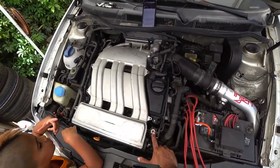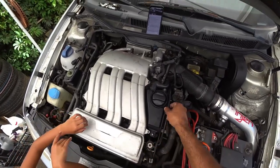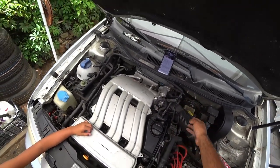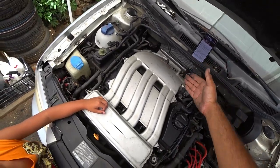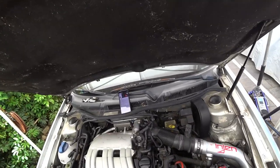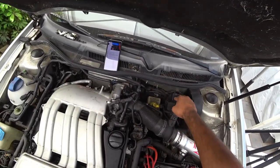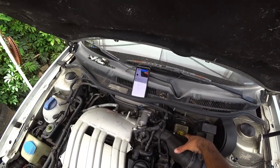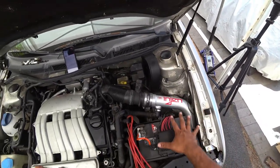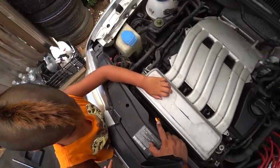Right here you have your fuel pressure regulator, vacuum controlled. The vacuum lines run all the way underneath the car and underneath the intake manifold. Let's see what else we see on top. Common on 1.8T is your main relays, your brake booster, brake reservoir. Obviously your battery and your fuse box that sit right here. That right there is your dipstick for your oil. Intake manifold.